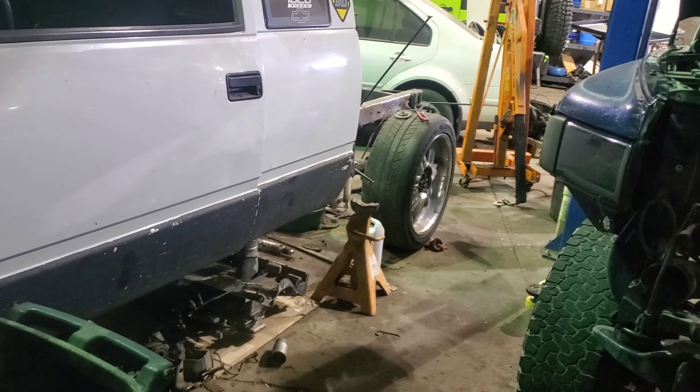It's a three-quarter ton with a half-ton heart — that's really one of the big things. I also worked on some port matching on my exhaust manifolds to match my big old monster heads sitting right there, ready to go on. Did some cleanup work, some port matching — didn't want to have to fight exhaust leaks and need the exhaust flow to match these big old honkers. The next will be the intake manifold; won't have to port match nearly as much. The intakes were already fairly big, so it'll just be a little bit of cleanup work on that.